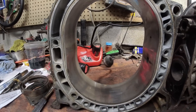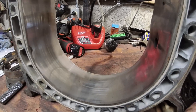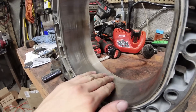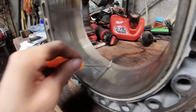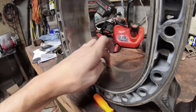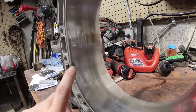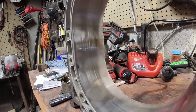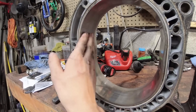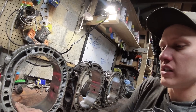This one is a housing from my 80 to 100,000 mile RX-8 engine. You can see it doesn't really have any excessive wear in here — you can just hear how quiet it is. I can feel a couple of high spots and low spots running my fingernail across it, but nothing that catches. You can see some edge wear coming in, and you'll see that a lot more with higher mileage engines. But arguably, this is nearly a perfect surface for a quick resurface and running a new seal.